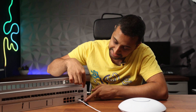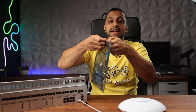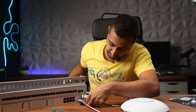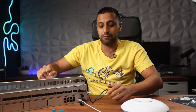Next we're going to connect up the SFP+ ports. To do that we need to use the 10 gig SFP+ modules — ultimately you want to maximize connectivity between these devices rather than dropping to 2.5 gig ethernet. We have a half-meter DAC cable: it's a small device, we take off these ends and they slide straight in. We pop the second one in just like so, and you'll hear that little click once it goes in. These two are now connected.